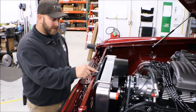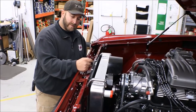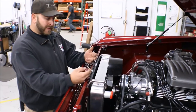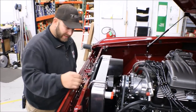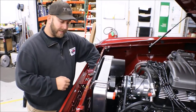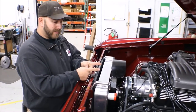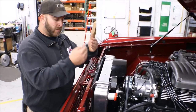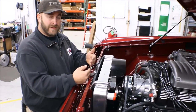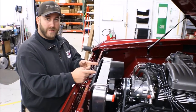As far as the top goes, you can take out three-eighths of an inch on this bracket here which will bring this whole thing forward. When you do that, you've got a safety latch plate that's behind here on the core support — it has two 90-degree pieces that come forward and will interfere with the condenser. You'll want to shave the profile of those down flat so that when you pull this forward it's not rubbing or cutting into the condenser.